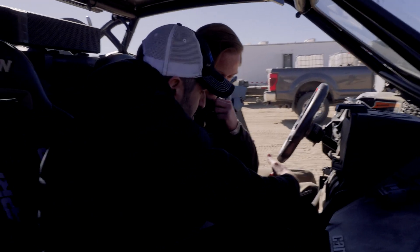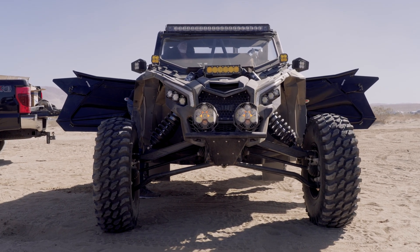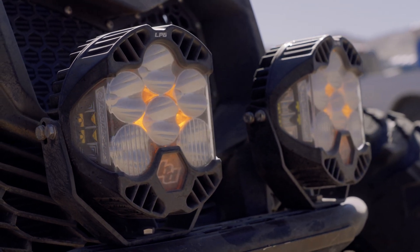They're all circuits — it definitely has to do with his wiring. We hooked up the VCM Scanner, read the codes, and he has seven or eight circuit and voltage codes. Looking at the machine, he has his aftermarket stereo system, aftermarket lights, all kinds of aftermarket wiring and harnesses that he installed. So I'm going to jump to the conclusion that he probably has a voltage or circuit issue from the aftermarket wiring.